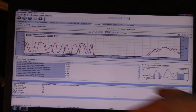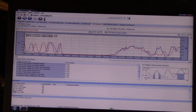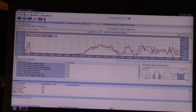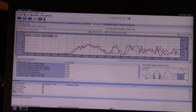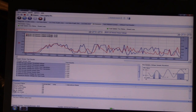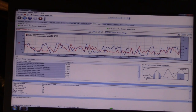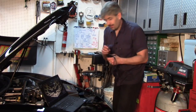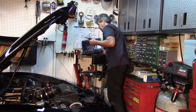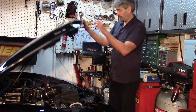That's actually pretty cool. Had we only seen the response in one bank, I would have assumed a possible check valve issue or clog in one bank and wouldn't have had to take the whole system apart. Everything that I said would happen as a response from the PCM to the air system happened, and every component was there. So we are done with that.